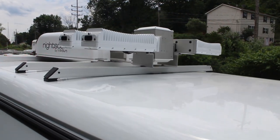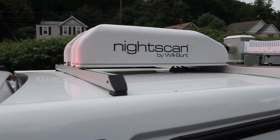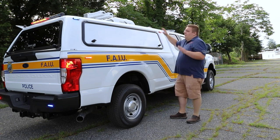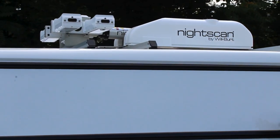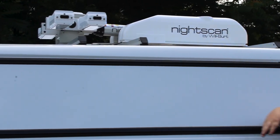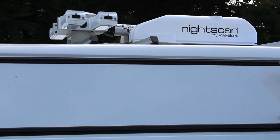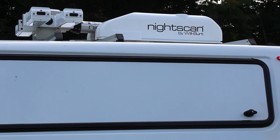Now we're going to set up the light tower. We've structured the roof to help support the weight — there's plating on the inside that we made, and aluminum anodized strut underneath the tower spanning the roof to help support the light. We have a 4-lamp Night Scan LED 12-volt light tower. On the strut, to give it a better appearance we 45-degreed the corners, and instead of leaving it open to collect debris we manufactured end caps for it, since nothing was commercially available.